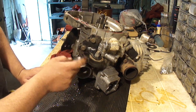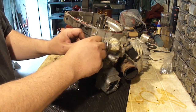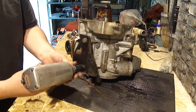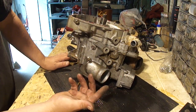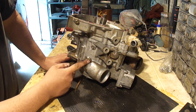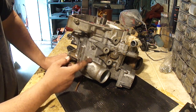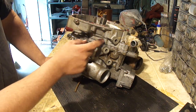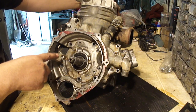This cover is held on by part of this bracket, so I'm going to take these three bolts out — these are 14 millimeter. Might as well take this bracket off too. So you've got three drains in the bottom of this motor: the one I showed you earlier, one for the balance shaft oil, and one for the crankcase. If you have any flooding you can pull those out and drain the crankcase. Before you take this cover off, you'll want to drain the oil out of this one right here.